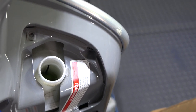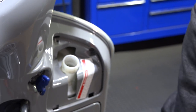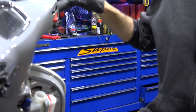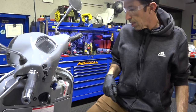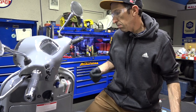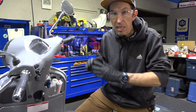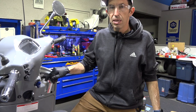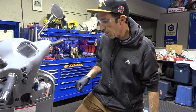If you're wondering how often to change the coolant, the factory service manual and owner's manual — Vespa Piaggio recommends every two years. I recommend the same, especially since modern organic coolants break down. The Maxima coolant will last a bit longer, and there are even 10-year coolants available, though I don't really recommend those for this engine as you'd have to completely flush it.